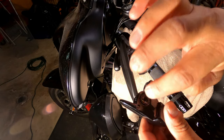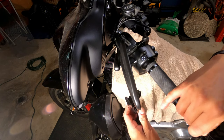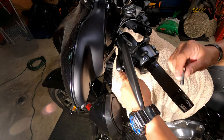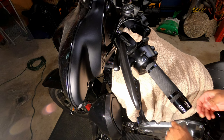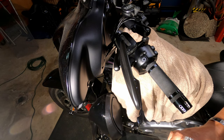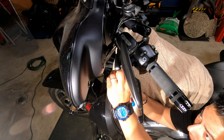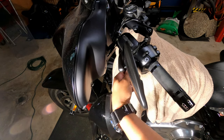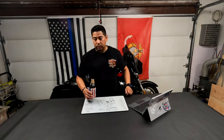You just want a little bit where the pin goes. This cup is going to fit in a little actuator that goes in there — make sure it fits. This little wing is going to go right across the front, then you can line up your hole. Pin goes in; make sure it's seated. Get your spring clip lined up — again, don't stretch it out too much. Put it on there, make sure it's seated, push up, and make sure it's locked. That was a real simple install, about maybe 20 minutes to get that knocked out.